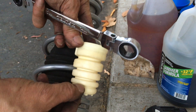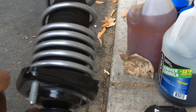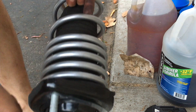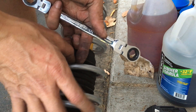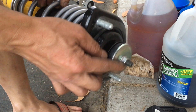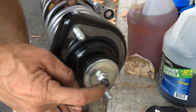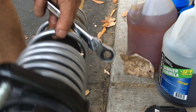I have this shorter bump stop — it only goes up to about right here. This spring is about three quarters of an inch shorter than the original, so the strut still wants to extend further up. I didn't even have to use a spring compression tool. I just pushed down on the top hat, got the nut on, then used a 5mm allen to hold it and tightened it up — 20 foot-pounds — and that was it.